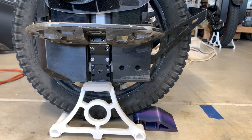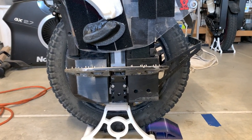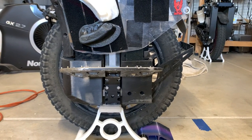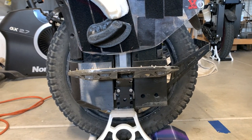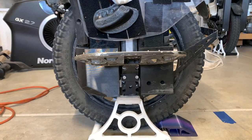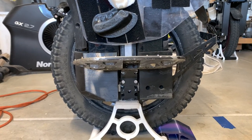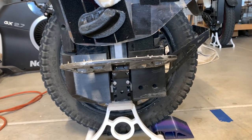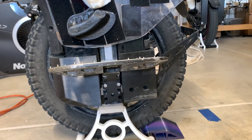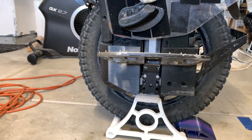Now again, this is kind of set up for what I want to do on the local trails close to me — it's not like I'm going up Mount Wilson every day. But that's the trade-off for having a very high pedal height: pretty bad center of gravity, less stable, but a lot more clearance for big rocks. Also a lot less likely to scrape on turns.